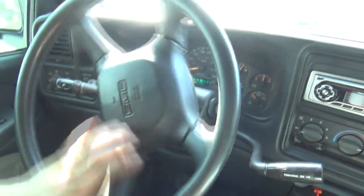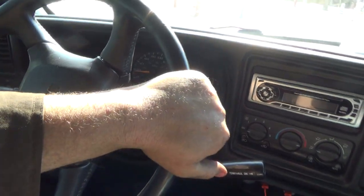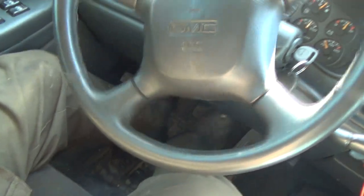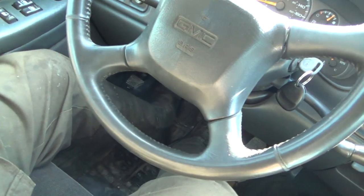They are sort of working, and sometimes you'll actually work that out of it, I've found. The more you use them, they seem to sort of come back. But I won't know till I get to highway speed, but I'm starting to engage there. So that's probably about right for the conditions that the rears are in. I know the rears don't do a whole lot, like 75-25 percent on the rear, but it's funny that I had no fluid at that one. Something's not right somewhere maybe. I don't know. She just probably wore out. That ABS module actuator thing's probably just wore right out.